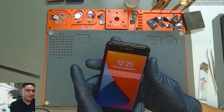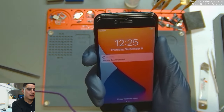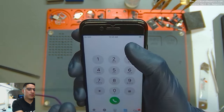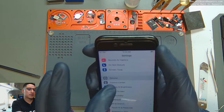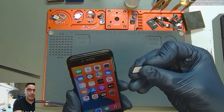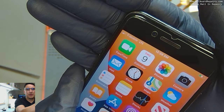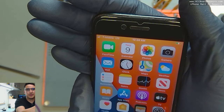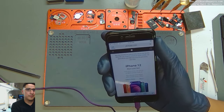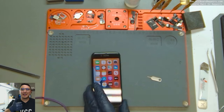Let's test this out. There's no SIM card installed — it says 'no SIM' as expected. If it had said searching or no service, that means there's a baseband problem. Dial *#06# — the IMEI pops up. Go to Settings > General > About, scroll to the bottom — modem firmware is present. Final test: with an actual real SIM card installed — right away, T-Mobile LTE with two bars of signal, which is reasonable here in this office. Loaded YouTube — all on cellular. Everything loads. This is a successful repair.